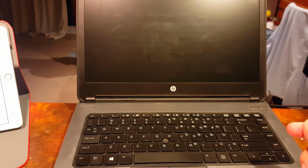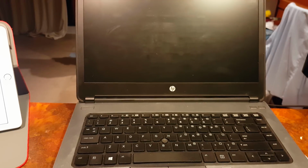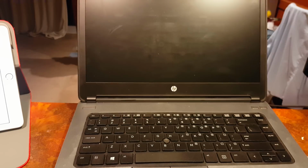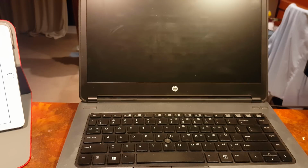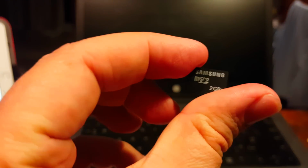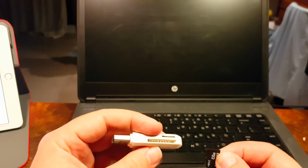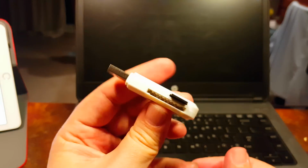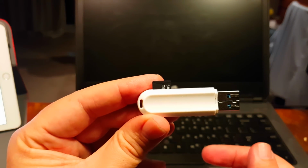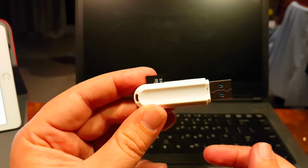All you need to do, you need to call HP support, give them an explanation of where you got this laptop and why you need it unlocked, and they will send you a small file. I'll put some links in the description. And then the trick is, you have to put this file onto a flash USB stick of not more than 2 gigabytes. I tried many USB flash drives and I ended up using a memory card instead of a flash drive, and the card reader. Very simple and straightforward. You have to format the flash module or the memory card with FAT32, not the normal FAT, not NTFS, not exFAT, FAT32.